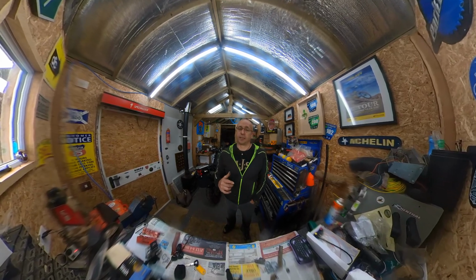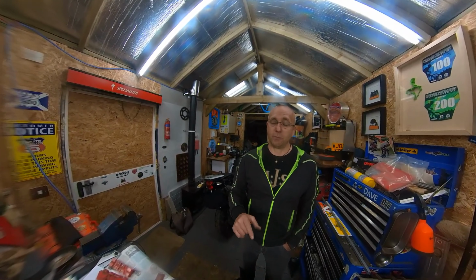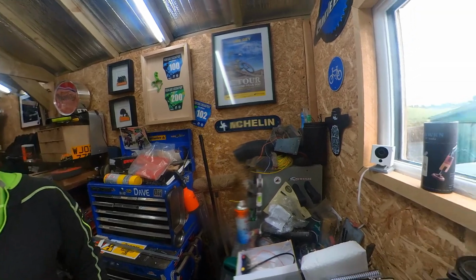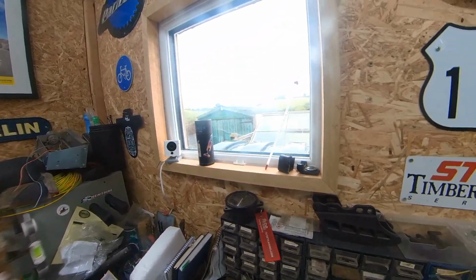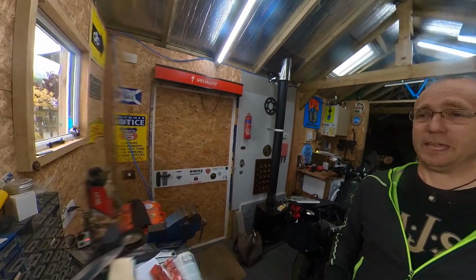After you've done this, like I said, there's a lot of people out there with some great videos on the how-tos. The thing is, you might find the problems. The problems are getting up underneath the head. You're going to need a whole different selection of spanners. All the plastic's got to come off. But decatting your Triumph, is it worth it? Given the option and the amount I've spent, I'm going to probably say, actually, no, it's not.